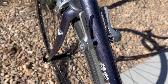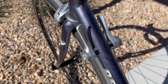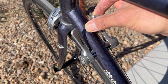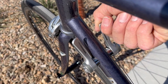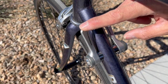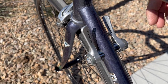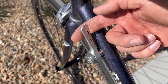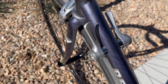There are specific hand techniques you get used to and memorize. For example, on the highest gear in the cassette I'll push my thumb and pull my finger up — in indexing mode it clicks right away. For the chain rings, because the Shimano light action doesn't go all the way down, you can essentially use only your right hand: reach down, slip your finger under it, pull up, and that gets you to the larger chain ring from the smallest one.